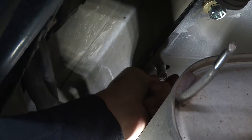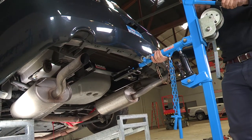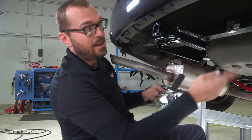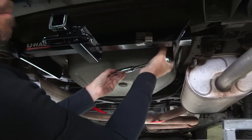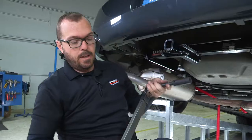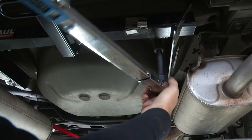Remove the fish wire. I've got a three-quarter inch socket — I'm just going to take all of the hardware that I installed by hand and snug it up before we put a final torque on everything. Now we're just going to finish our fastener install by torquing everything down to the final torque spec that's called out in the instructions.